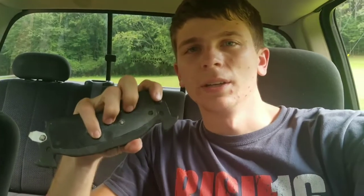I also ran into another issue. These pads are from Advance, and if you can see this little nipple right here — the factory ones do not have that on the side that sits towards the piston of the caliper. That nipple is hindering the brake pad from being able to slide in between the dust cover and the rotor completely, like it's supposed to. So I'm also going to stop by my dad's shop and knock that nipple off real quick, then run to the parts store. I also have to pick up a couple groceries, so hopefully we'll make it back in time to do some more work on this thing.